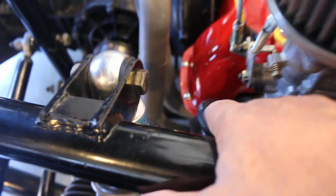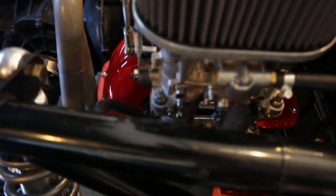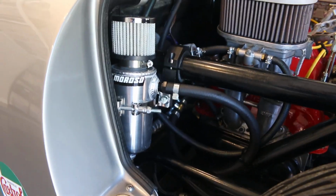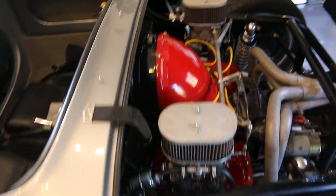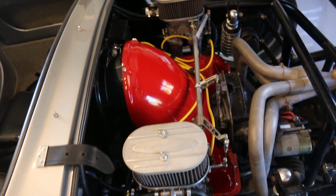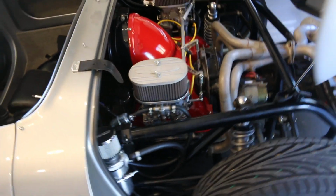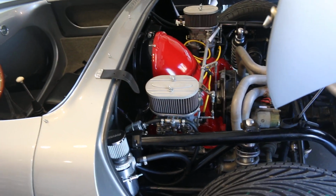Each of the heads, you can see here. Maybe you can't because of the focus. Hold on. Well, I guess I can't. The heads are vented through these lines, which go to a catch can, and then to atmosphere, so we catch at least the liquids that come out. Okay, and now the cooling system. This is a Sharp-built 911 style shroud from Australia. This is a new shroud which I put in. Mike's still alive. He's still making shrouds and still souping up dune buggies.